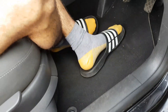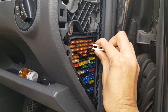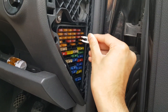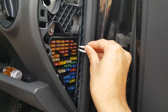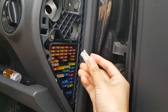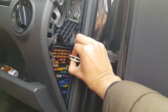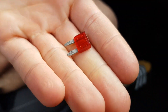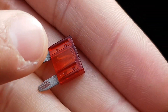So this should be a 10-amp — it says 10 in my fuse box. You want to take it out with this tool. Take this one out — turn the whole thing around 180 degrees, use the other side. Hold it down and pull it. There's the old fuse out. Now look, you can see in the middle it's gone black — it's cracked and broken.